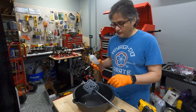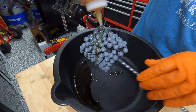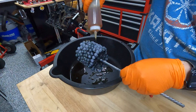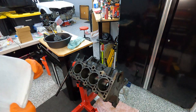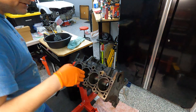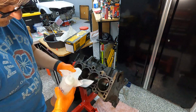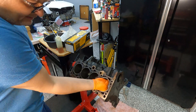The first step is to get the oil completely covering every single one of these little honing balls. I've got my 10W-30 here and I'm just going to do a cross coverage and then turn it. That looks pretty good — every one of them is covered. The next step is to lubricate the inside of the cylinders and then hit them one at a time. I'm going to do about 60 strokes, speed it up for the last few, then pull it out and move on to the next one. Get them nice and lubed up.